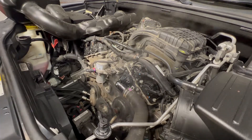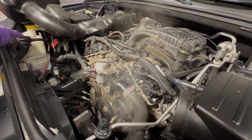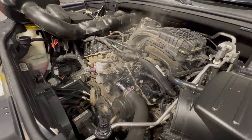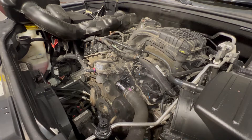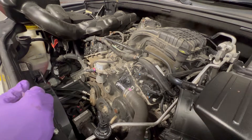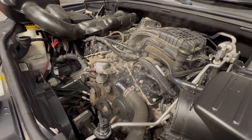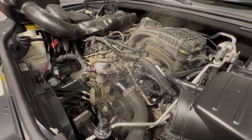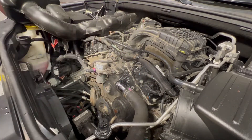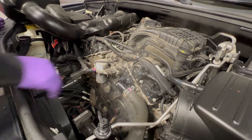Fill in the cap and let it sit. What you're going to want to do — antifreeze does not like to dilute and dry out. You're going to get water and squirt it on the engine. Yes, I said put water on the engine. The best bet is to put water where you took the antifreeze off — where you see antifreeze, pour it on there. Don't dump the whole motor, but just dump water on the motor where the antifreeze is. It'll help it go away.